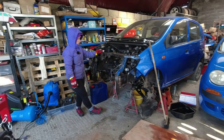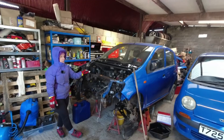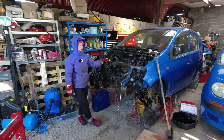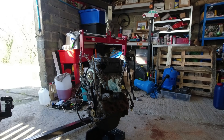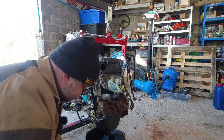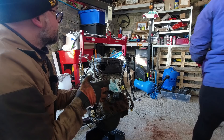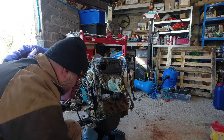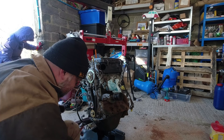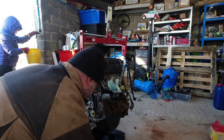What do we do now? You want to clean the engine, so you're going to start with the toilet brush drill attachment — it isn't actually a toilet brush, the head is designed with a shank to go in a drill. I'm going to get on with refitting this water pump. I've got my red caliper grease to encourage it to go in. Could I have some degreaser? Good suggestion. The good news is if the water pump does leak, it's not too bad a job to redo because it isn't powered by the timing belt.